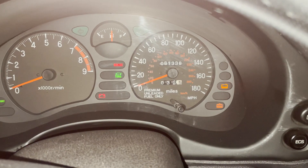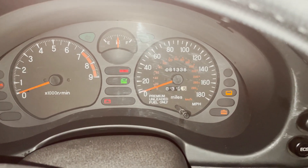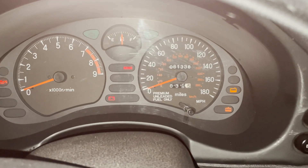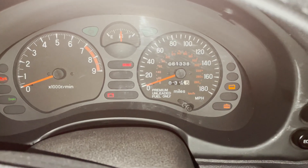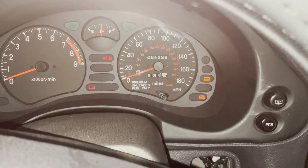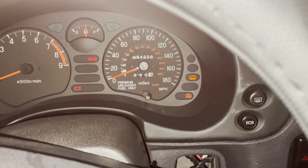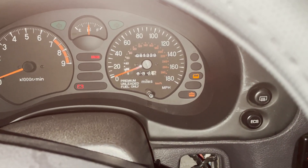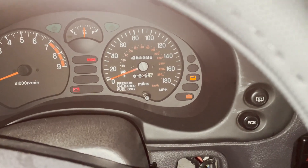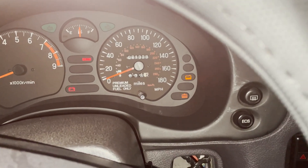Here's the moment of truth. My wipers were on because I had to put the lever down to access it. As you can see, it's off. Let's press touring - there you go, touring comes up. Turn it off. Turn it on. Turn it off. I think with that I'm ready to put the switch back in place. If you have the same problem, this is how you can fix it - it's just about fixing the broken tab, super gluing it or doing plastic welding, and putting it back in place. Make sure you test it before you put it back because it's going to be difficult to take out.